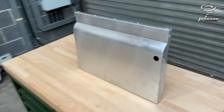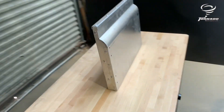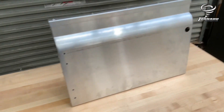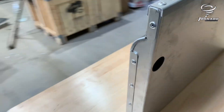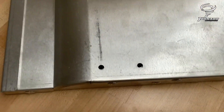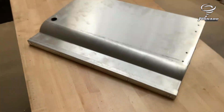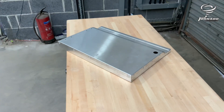So the door — very simple, quick job. All fits together really well. The top capping section is longer on the outside than the inside. Both sides are exactly the same part. The hole at the back is for the push-and-catch, same as the bonnet pins — Suffolk Speed features, with enough room for the nut on the back. When assembling at the front, there is a 2mm angle plate that fits inside here — it's slightly ajar from the holes but all fastened in. I'll just touch that with a drill before I fasten the door on; that gives it stiffening at the front. Not essential, but I thought it'd add a bit of strength. That's the door done.